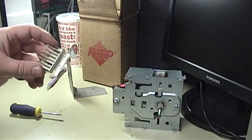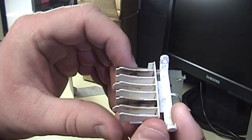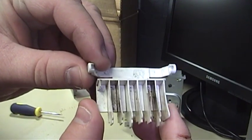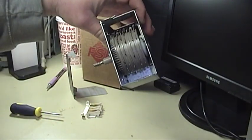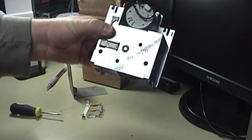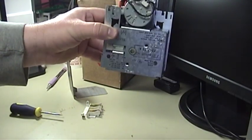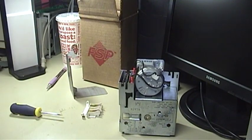Today it's still available and relatively easy to replace. You can probably better see some of the results from the arcing and burning damage as the contacts heated up over the years inside this plastic guide that surrounds the contacts in order to prevent short-circuiting. But that's a basic tutorial on how one of these things works, and it also shows you what ended up going wrong and causing this one not to work. This timer assembly is pretty much toast. Even if I cleaned up those contacts, they would probably fail very soon again because the silver plating on them is gone. However, I think I might hold on to this little line synchronous motor as it might be useful for making some sort of a clock or actuator. And it still seems to run perfectly well.